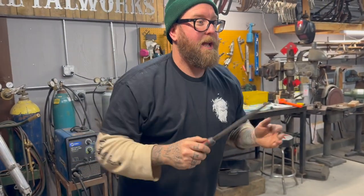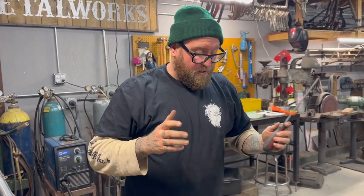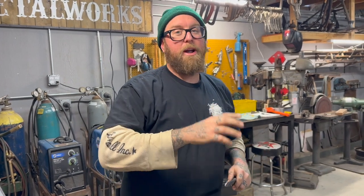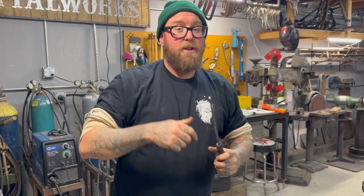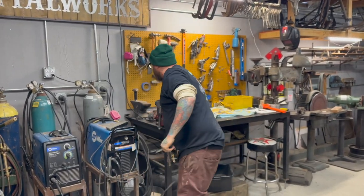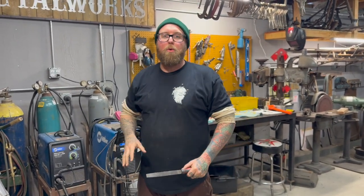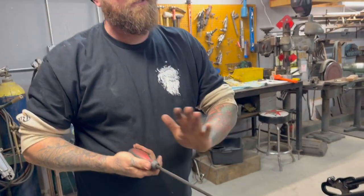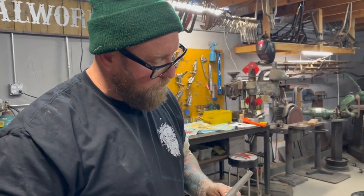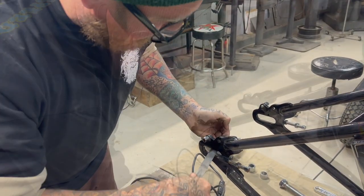That's where, in the fabrication world, I had a guy that taught me a lot of stuff that I know. His first thing was, you need to know when to put away an aggressive tool, because you will overly chew stuff down. So use a nice tough guy grinder and all that stuff, but know when to put that tool away and start digressing into a file. And filing's a bitch. Having good files is also really helpful. I'm probably due for some new ones, because otherwise you're not doing anything but rubbing metal against metal.